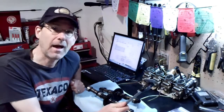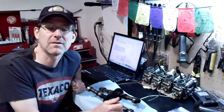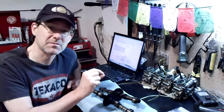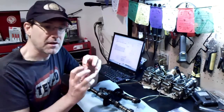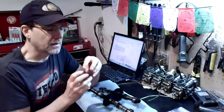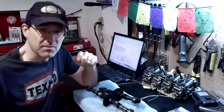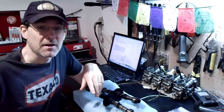If you don't have one of these slide rule calipers, they're ten dollars, they work, get one. What you don't want to do is just pull these cams out and assume they're fine and throw them back in. A micrometer isn't that expensive either — good things to have in the shop.